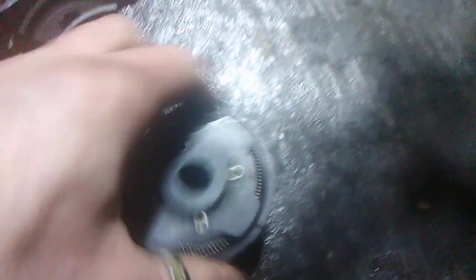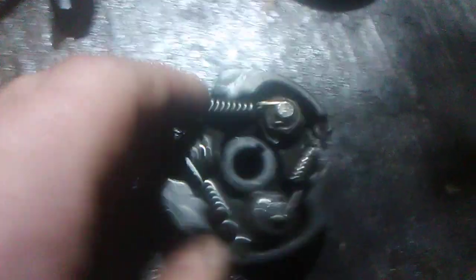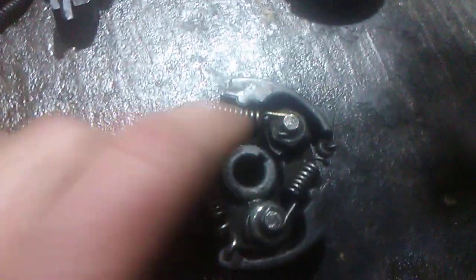And it's like J-Rod said — if they would make these clutches that go behind this gearbox and attach to the engine, if they would have made it to where there's a spring here and a spring here, and then inside where these stretch out there's some kind of return spring pulling them back — as soon as you get off the throttle, the clutch retracts. That's what these did. You give it throttle, it's spinning, and then when it gets to the high RPMs this shit opens up. But the problem is, when these springs get hot they snap. And once they snap, it no longer gets the RPMs that you need.